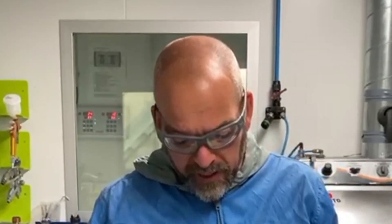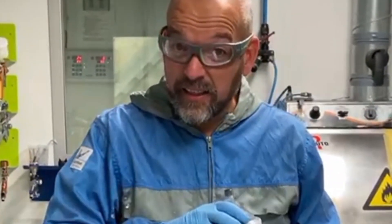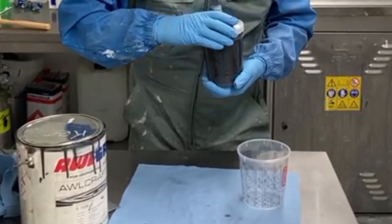Right, so you saw us in the booth. We were able to put a stripe in there to show that over-application can give a dark line. The right-hand side of the panel I over-applied, and you can see a mottling — that's a very different type of mottling to an under-applied mottling. It almost looks like it's flowing and running within itself and you get this dark edge. Because we've got some base coat on there and it is almost like a sponge, it soaks up the second coat.